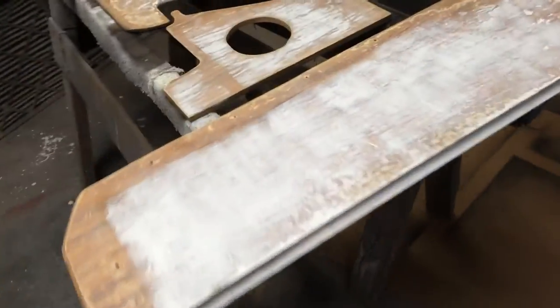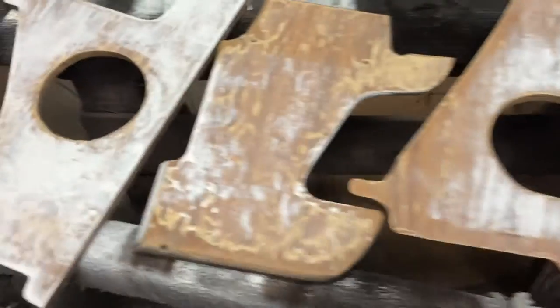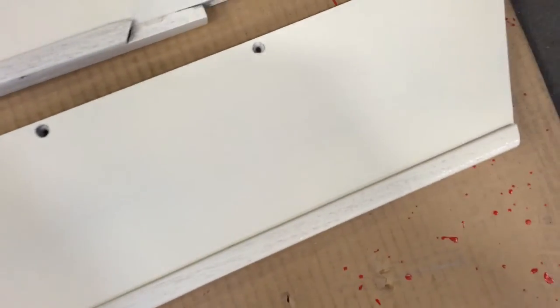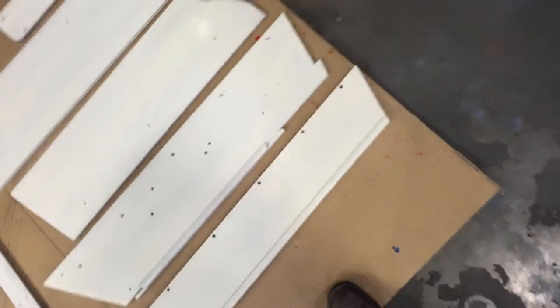First coat. We've got this pretty sweet paint booth at work. These are unpainted pieces. Really should have primed them again to see all the low spots. Anyway, turned out okay. It's just the first coat. Needs a light sand of 220, then another coat. More pieces need to get done.